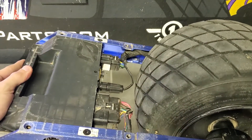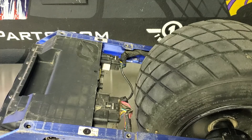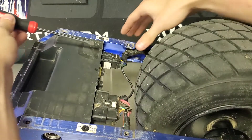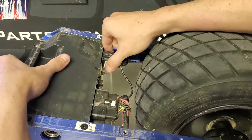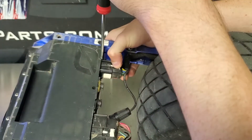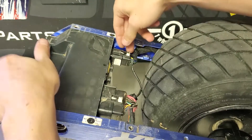The other two cables are going to be a bit trickier. Those are going to be for your motor as well as for your battery to secure power to it. They have a plastic tab right here that we're going to have to push out before we can actually unplug those. I find it's easiest to use a flathead screwdriver to push and nudge these out, unlocking them. Once we've got those tabs out, there is going to be a black piece that we're going to have to press down — this unlocks the cable from the port. There's a little piece of plastic on the port that sticks up that this cable locks into. A lot of the times these are very difficult to unplug; there's not a lot of tolerance, so they get really stuck. I find it's easiest to take a flathead screwdriver and sort of pry out on the edges while pushing down on the unlock to loosen it up a little. Once we've gotten that off of the hook, we can just go ahead and unplug it.